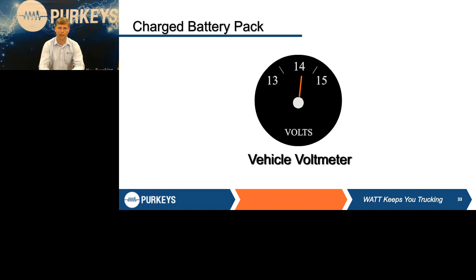And this is something you'll typically see through fall and winter, where you don't have nearly the electrical loads. You can have a defective alternator all that time, but loads are small, so everything looks good. When we roll around to springtime and start turning on the air conditioner and some of the extra loads, suddenly we have a road call because that alternator finally gave out. With low loads, everything looked good. The other thing too is if you do have one diode out, what are the odds you're going to lose a second diode? Now you go from a 90 amp alternator to a 45 amp alternator. So a voltmeter, especially the vehicle one, is not ever a good diagnostic tool.